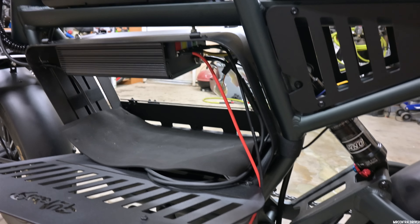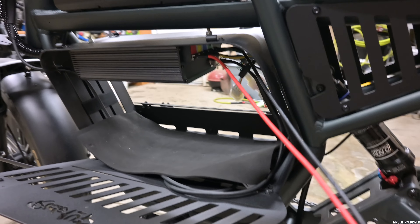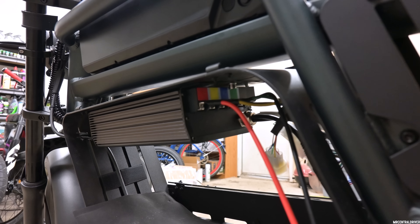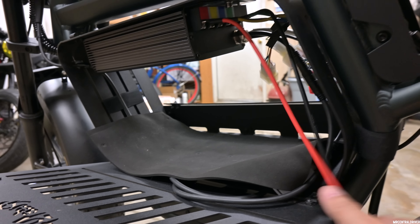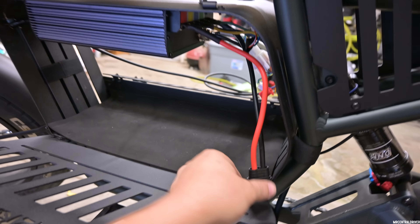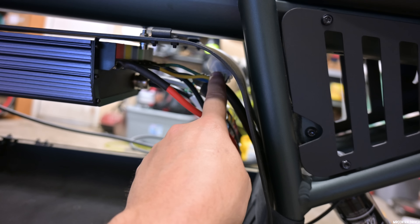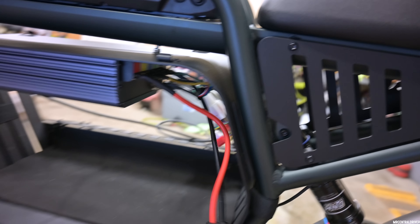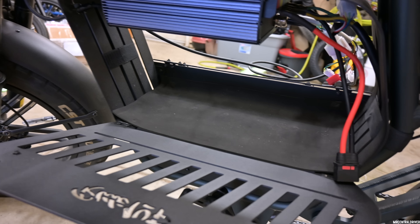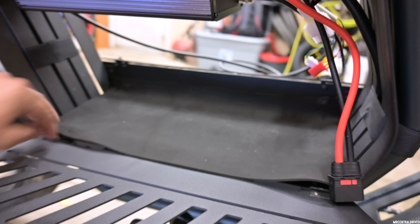I already have a wire connected from testing the motor earlier, so you won't have these two cables, but the concept is the same. You have a power and a ground — red and black — 10 millimeters, and you can use a screwdriver but it has to be short because you don't have a lot of room here. I removed the old cable and installed the new one for the new battery. I like that the new cables are short so they don't take up a lot of room in this cage. After you hook that up, push all your cables towards the back on the other side, then open the cage so you have an empty spot to slide the battery in, and make sure your foam liner is down.